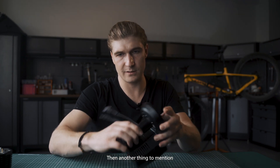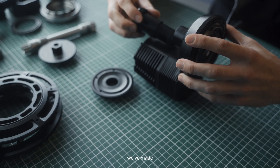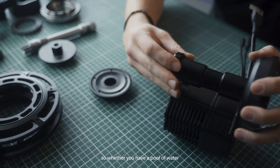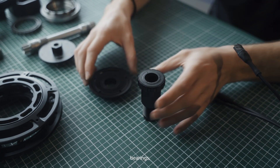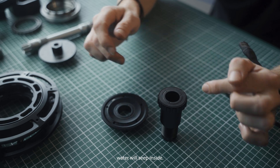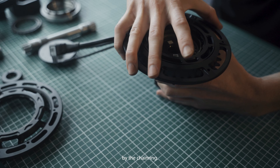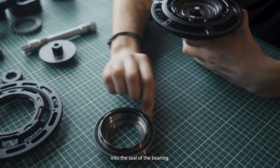Another thing to mention as we dive deeper into the Photon is the attention to waterproofing. Inside the bottom bracket where water generally pools up, we have an O-ring that seats within the body itself, so whether there's a pool of water inside or not it's not going to penetrate. For the left and right bearings we have nylon covers, so if you pressure wash them they are sealed. The same applies to the final stage bearing — there's a shield behind it, so water would need to pass behind the chainring, through another layer, and then through the bearing seal.